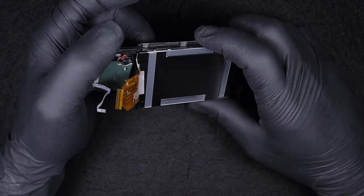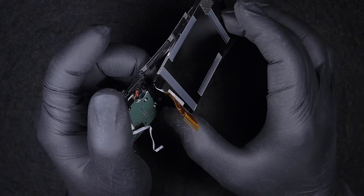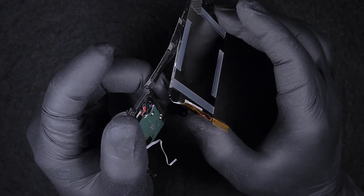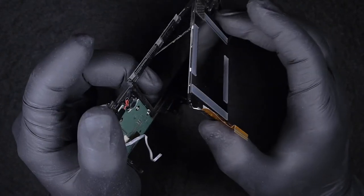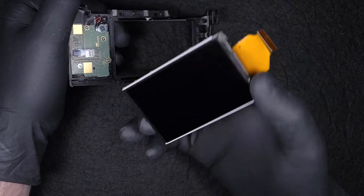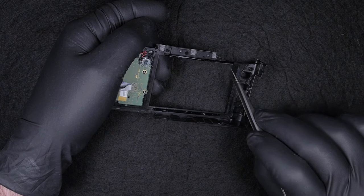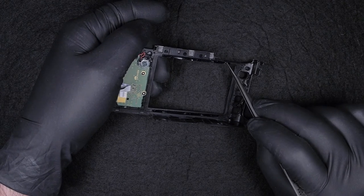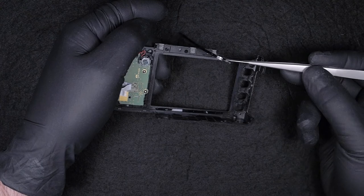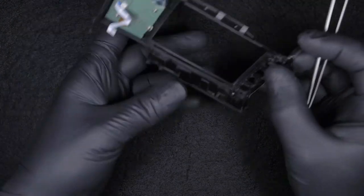As I mentioned, once you disconnect the LCD screen from the back, you need to replace the double tape. And this is not a normal double tape. It's a foam double tape, a foamy double tape. It's like half millimeter foam, and on the sides is the tape. This one here, there's no way to save this double tape. Once you disconnect the LCD screen, this will be damaged.